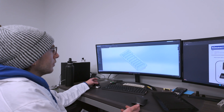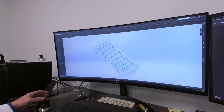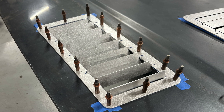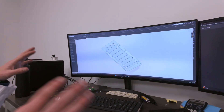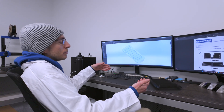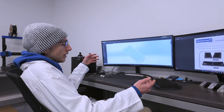Here is an overview of the louver itself. The point I'm looking at here is the rivet holes — we've got quite a few on this piece. That's because the louver is still kind of a structural part of the hood. Oftentimes you'll see people at the track lift up their hood and it's flopping around because they've just got big holes cut in it. So we wanted to try to retain and build some structure back into the hood, as opposed to just having a hole in a piece that sticks onto it.